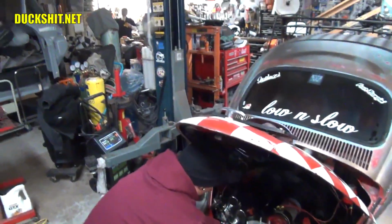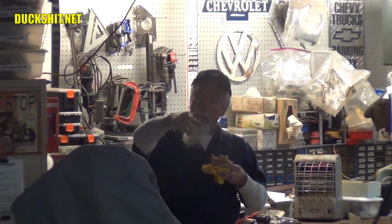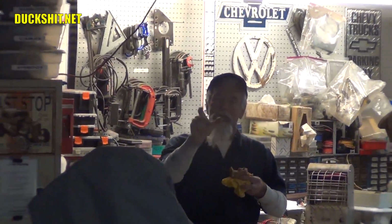I'm about to steal your dinner. And the throttle... I'm smelling that in here. Yeah. On the carburetor end of it, when you pull it all the way forward, the cable run needs to be trimmed back a little bit. Yeah, maybe a little bit. About a half an inch or so.